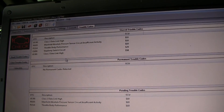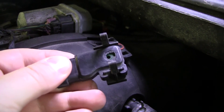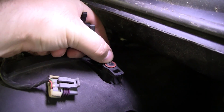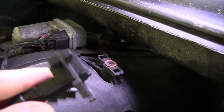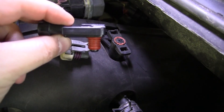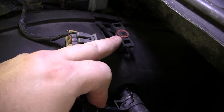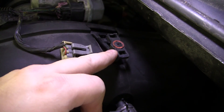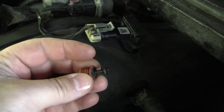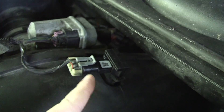I guess I'm off to get a MAP sensor. I was pulling it off to check it and the plastic is broken. I assume there's some kind of nipple down in there that I need to get out — yeah, definitely need a new MAP sensor now, so maybe that'll get rid of that code. New sensor procured, and look at that — the orange seal comes with it. I tried running a wood screw into that little hole and pulling the whole thing out since I couldn't get a hold of anything there. That was pretty drama free — found a somewhat small screw, screwed it in, pulled it out, and got the new one in.